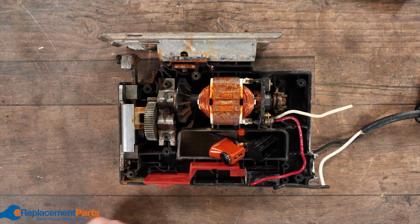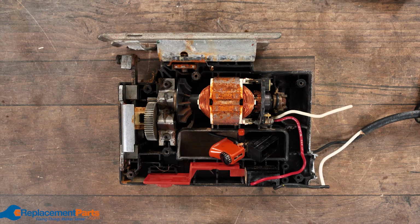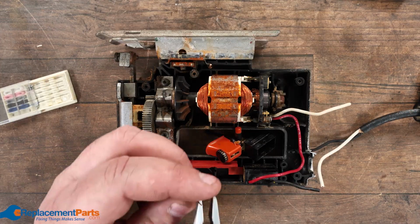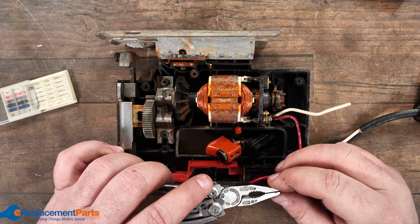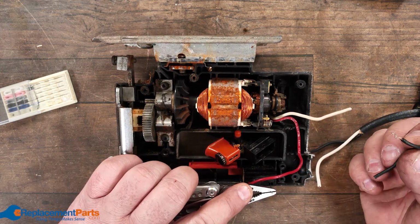If we're looking at the switch, these wires actually just push in and they're locked in. The simple solution to remove those wires without having to open up the switch is using a needle. So if we look at our black wire, I'm just going to take a pair of pliers to hold the needle. I'm going to come in between the two, and it might take you a couple tries. We'll just push down, try to feel for that spring. There we are, in the first try.